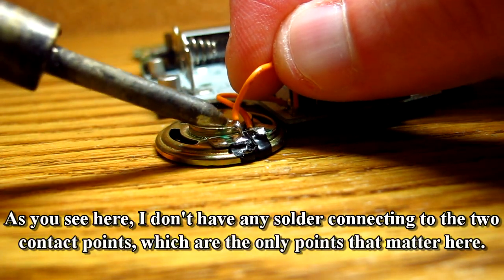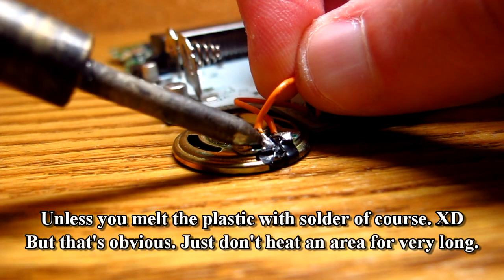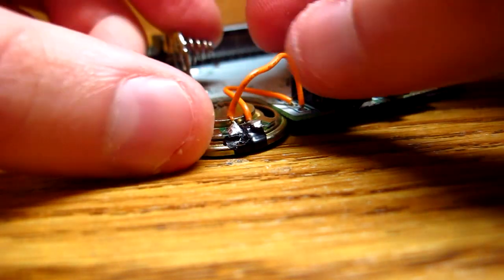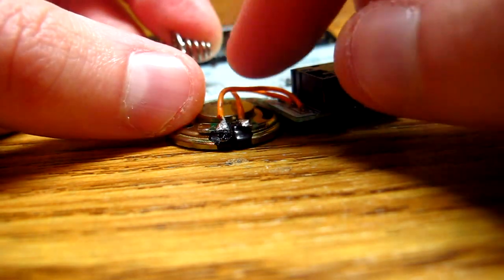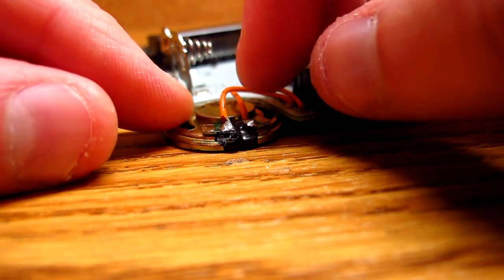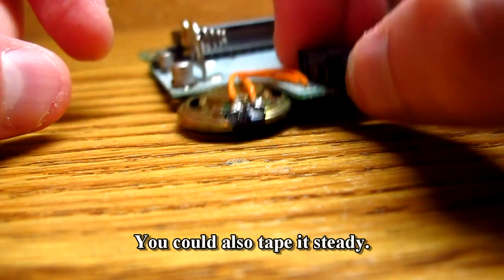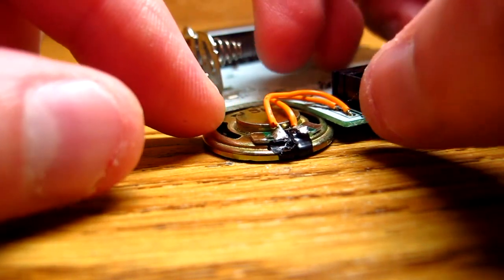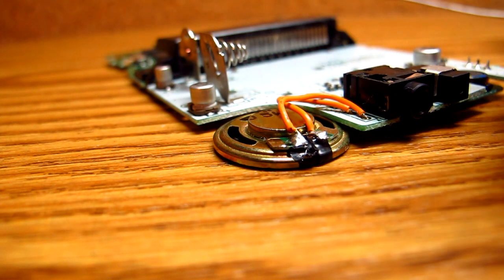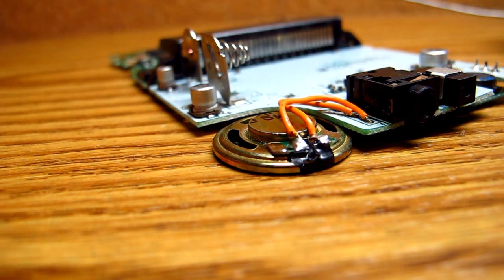Alright, now let's try this again, now that it looks like there's enough juices. Get it all molten. I'll have to situate the wires differently because the speakers' backs are different. But because the speaker is thinner, I'm going to lay the wires across it on the top like this, so that it has a tighter fit when I put the case back on so it doesn't rattle around. You'll notice that I put the wires back where they were before on the other speaker — this wire was on this one, this wire was on this one. It's all pretty intuitive really. Just follow how it was before.